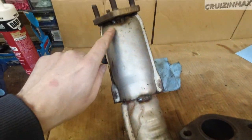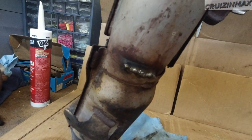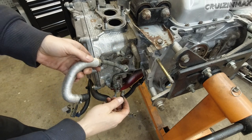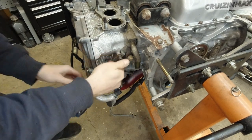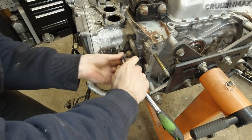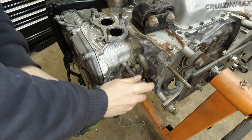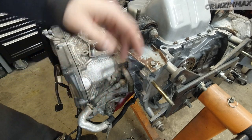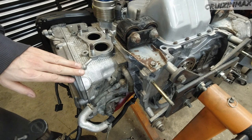I had to do some welding - this hole, this heat shield came loose on me. Alright, before I put the exhaust manifold on I need to put this oil line back in. The torque specs are 21.4 - I think that's for all of the banjo bolts that attach to the heads. So it's 21.4; I'm doing 22. Torque specs for these is 29. I'm also going to do it in two steps, bring it up to about halfway - 13 to 15.